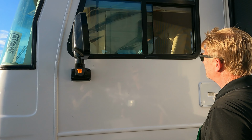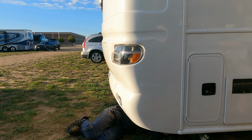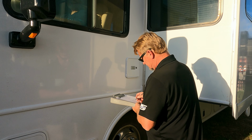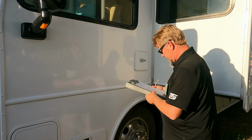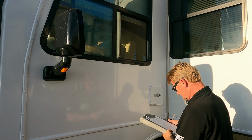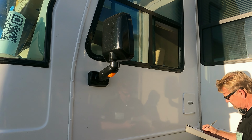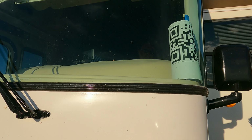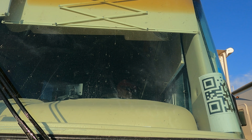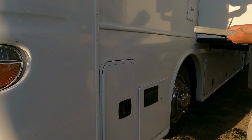So right now I've already looked at the steering gear. Now I'm looking at the front drag link. Front drag link end looks okay. That drag link end also looks okay. Intermediate link, tie rods look okay, haven't gotten there yet. Okay, this does have the older style 3-bolt bell crank. The SS100 would be an upgrade. On this particular one, I'm not seeing a whole lot of side play in it. I do think that we could help free up the steering though by going to that SS100.